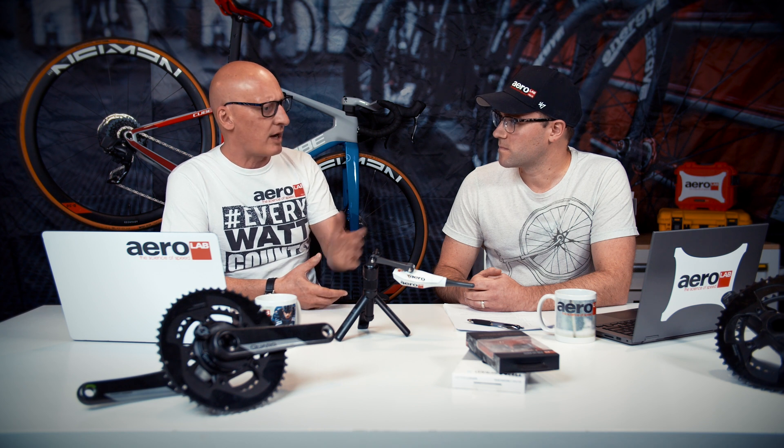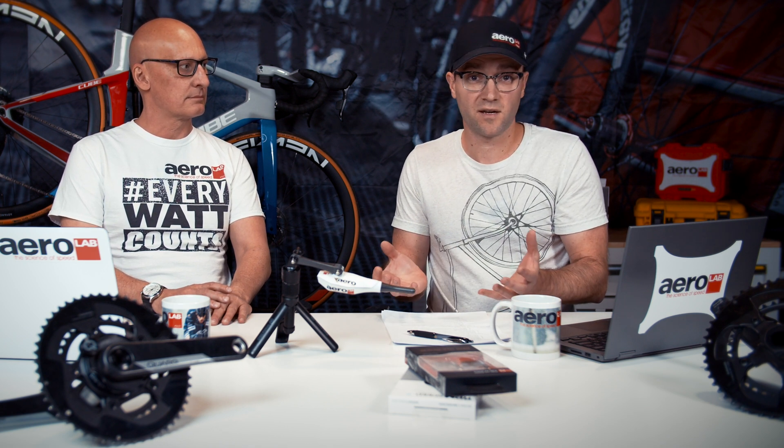Why don't we talk about some of the sensors — why we're picking certain power meters? We're not by any means biased to the power meters. If you're using a single-sided, that's great for training and so forth. But some of the power meters Chris is going to talk about we like because of their accuracy and drivetrain loss. A lot of this information can be found on our website regarding the performance of different power meters — I wrote a blog article on it recently covering all the different power meters and their slight variations. Without a doubt, one of the most important things is if you plan on doing aero testing with a sensor like this, stick with the same power meter throughout those tests. Try not to switch to different power meters. We prefer dual-sided power meters — ones that enable you to measure imbalances between left and right — or a hub-based or crank spider-based power system. Some examples of those are in front of us here.